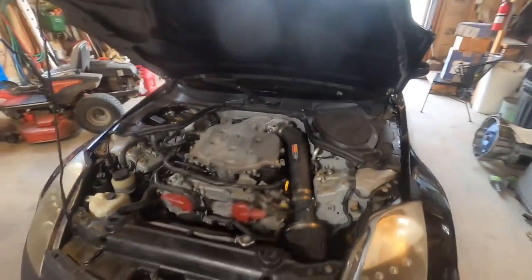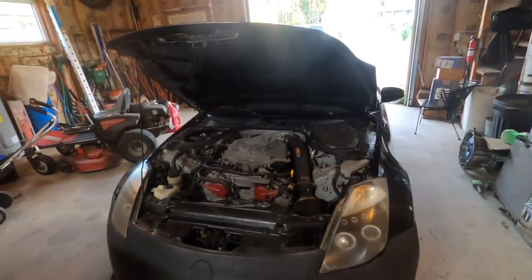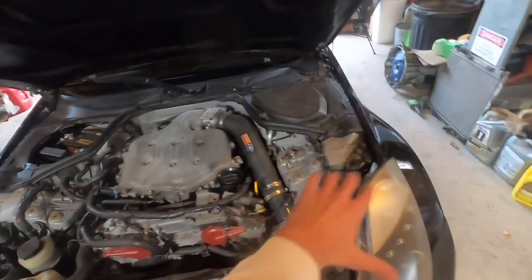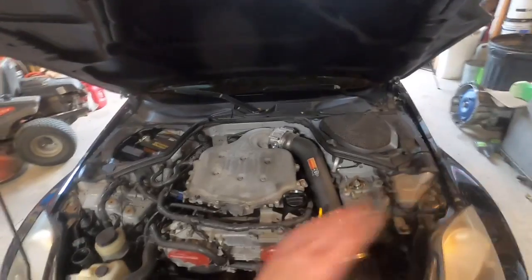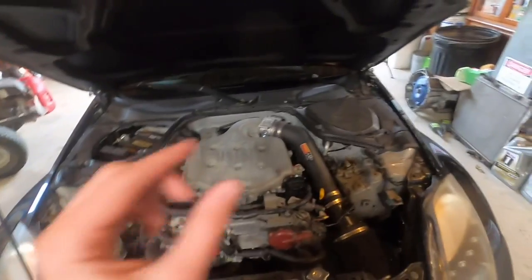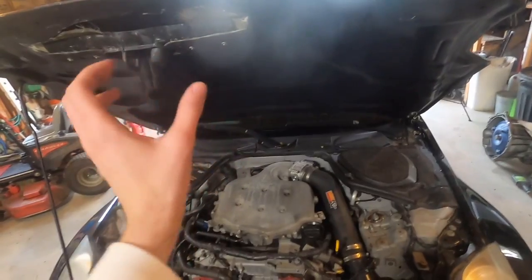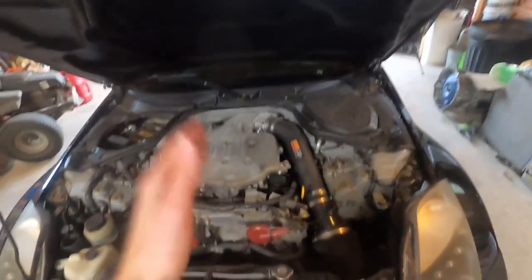That's my problem. I know everybody else that's a really skilled mechanic is going to say, well, it sounds like... and I'm willing to do a horrible job. I was honestly thinking that my best course of action would be to pull the motor out, take every single wire, every single sensor, and disconnect it, take the entire wiring harness out, and go through every single wire in this car and make sure no wire has a short, and if it does, fix that short. Then plug it all back into the ECU with a brand new ECU connector and make everything connect perfectly so that nothing's loose in there, then wire it all back into the motor, put the motor back in, and put it all in the correct way.